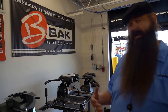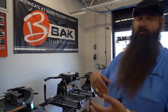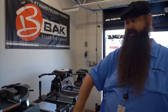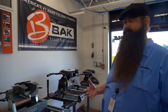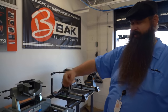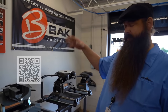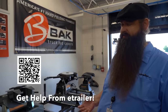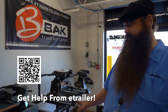There is another wiring component I tend to suggest with fifth wheels. If you look at a lot of fifth wheels, especially when you're looking at them down the road, they have the wire coming out of their kingpin, and it goes over their tailgate and then down into their plug by the bumper. I don't like that because you can tear up your tailgate doing that. We have a lot of different options where you can actually mount a seven-way inside your truck bed so you don't have to drape it over your tailgate — you just plug it right in. I think it's better; it's a cleaner look and you're not messing your truck up. Look on our fit guide under wiring — it shows all those options. They're not necessarily needed, but it's something I always like to mention. Fifth wheel's pretty straightforward: as long as you got your hitch and your wiring, you're good.